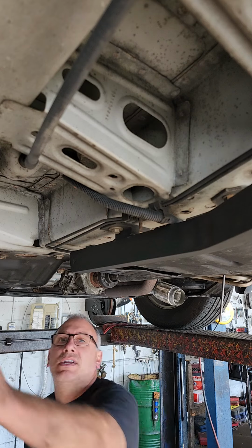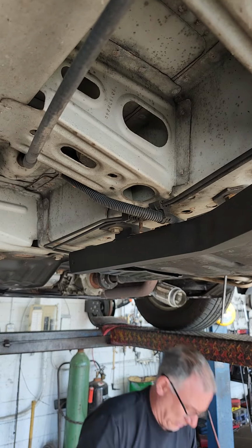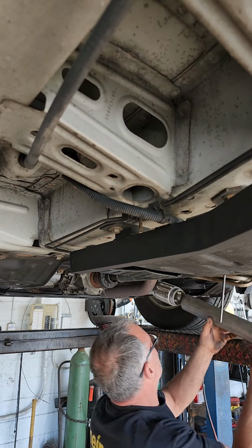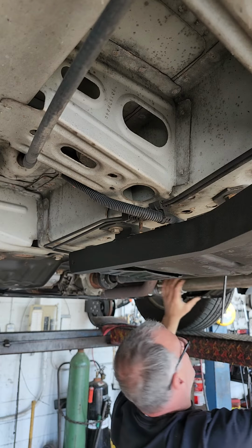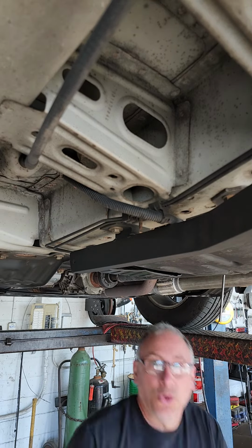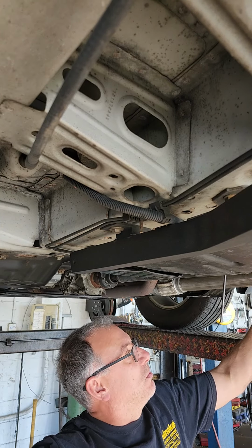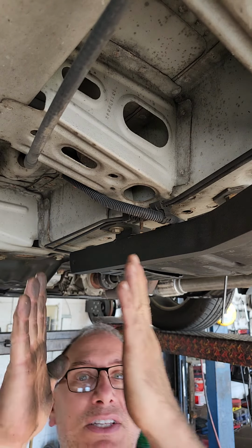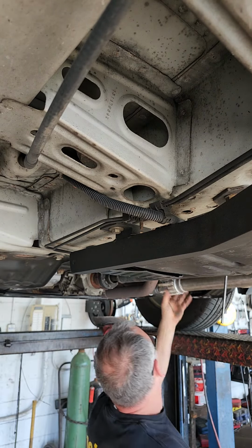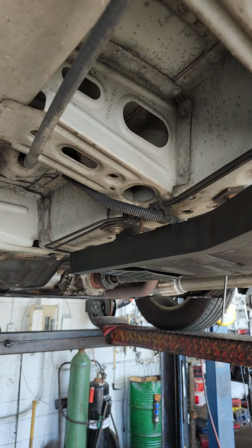I hope you're still there. So we're gonna shape this again. And what I'm doing is preventing me from taking another step in doing this job. So by shrinking, we're shaping that end with this cone. I have enough material inside of this to weld, or I could butt weld it. I wanna make sure my hangers are all straight in the exhaust job here. So everybody's looking good. So let me show you how we do this. And then make sure you dial that regulator back.